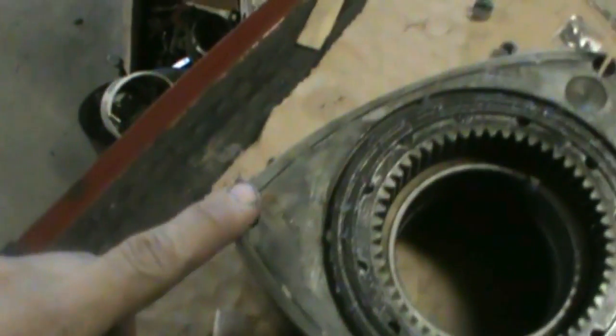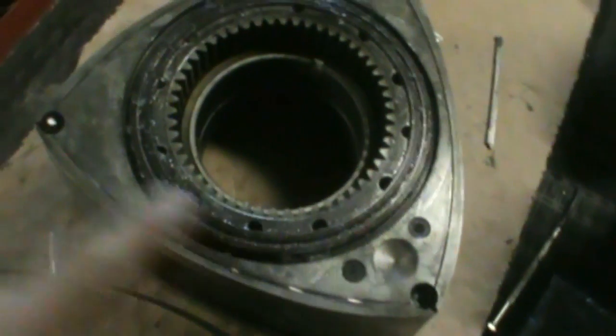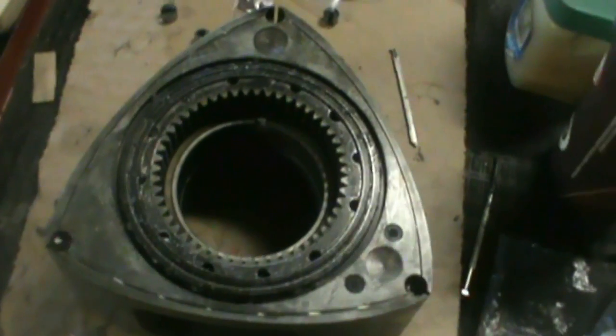Alright, so I just went around and put in the corner seal springs and the side seal springs, so you can see those in there. I'm just about to put in the seals, but first I'm going to put a big glob of Vaseline in each one of the corner seal grooves, and then pack some in where the side seals go, because that's what's going to hold it all in place while it's waiting to get assembled.